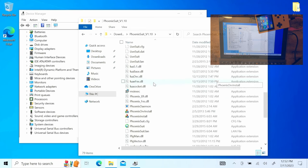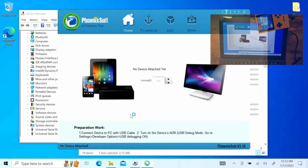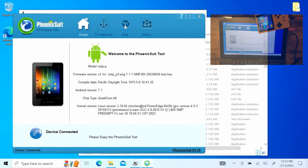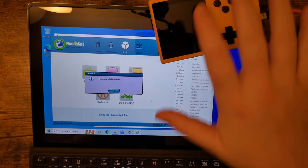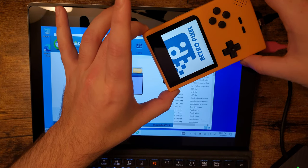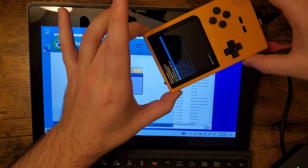The other driver we can't really test without using Phoenix Suit, so let's go ahead and start that up. Find phoenix_suit.exe, run it, and confirm the UAC prompt — it should start right up. Another confirmation that our driver is working is that the page will go from 'Device Not Connected' to showing device info about our specific device. From there we can do a couple of different things — one neat thing is if we go to the APK tab, we can click Recovery and it will reboot the RetroPixel Pocket into its built-in recovery mode.